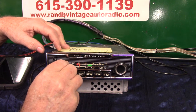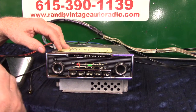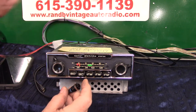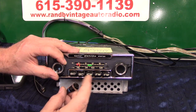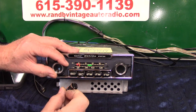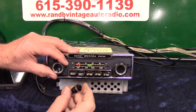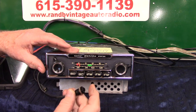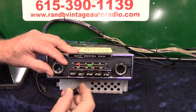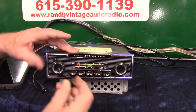Get a little volume on it. Take this push button and tap it three quick times and hold it down. Every time I do that I go to the next phase. When I get to where she says EQ is on, keep it held down until you go into the settings — that's how we get to settings. One, two, three, four — loudness on. Again: one, two, three, four — EQ on. Hold it down.